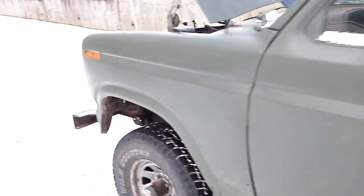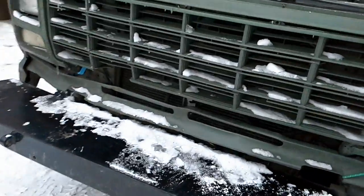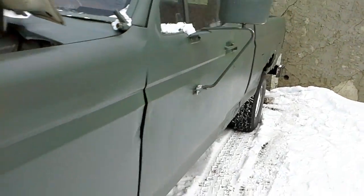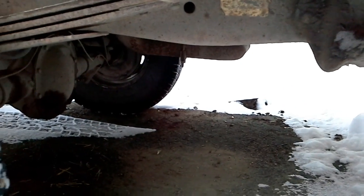Updated the front axle out of a '94 F-150. I'm having a major oil problem right now — I think I found the culprit. We've got the standard 8.8 in the back; ABS is disconnected. Exhaust is straight piped with an empty cat.